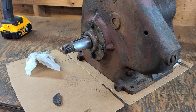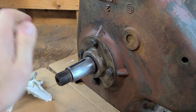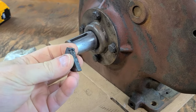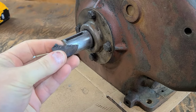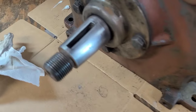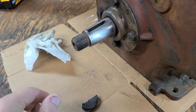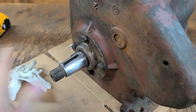We had to get a little bit more aggressive with it than I wanted. The friend that I have that mounted the tires — I went down to his garage and we used a big, huge torch and we torched it out, essentially. You can see it took a lot of energy to get this thing out. It was really pressed in there, which is weird. But the slot itself is mint — it's perfect. I just got to sand it out, clean it up with a Scotch-Brite pad. And I've already got a new Wisconsin Woodruff Key for it, so it's all set to go.